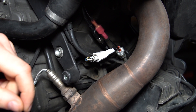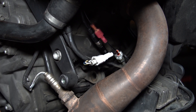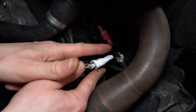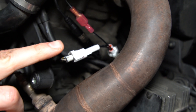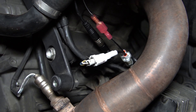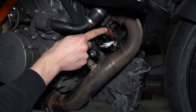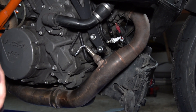It is important to be careful that the Drehzahlsignal is on the yellow cable. Within the KTM models, this varies a little bit — the two wires can be swapped. That means the branch connector's red wire from our Stecker, if it is not on the line of the yellow cable, you might have to swap the pin. That varies between the different models, but this connector is the same across all KTM models over all the years. On this connector you then put the black cable that goes up to the Cumpan display unit — this is the Drehzahlsignal.